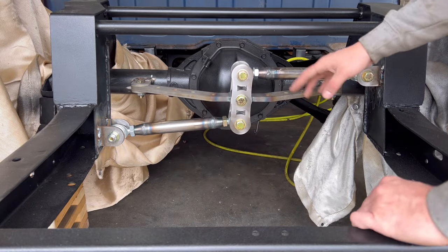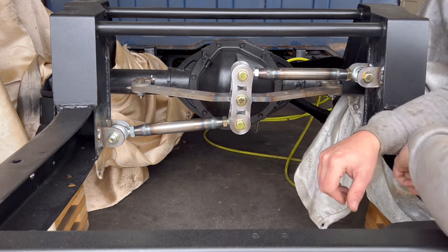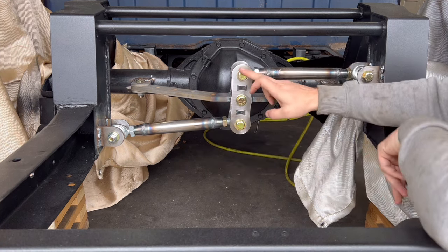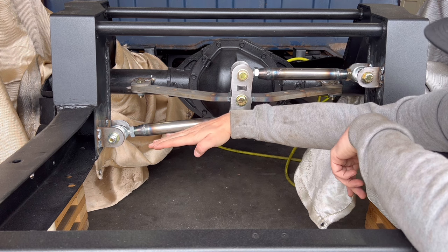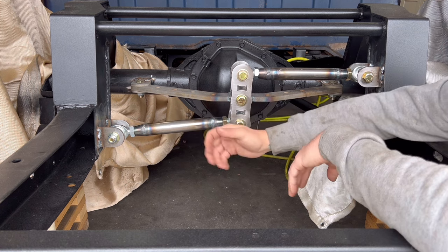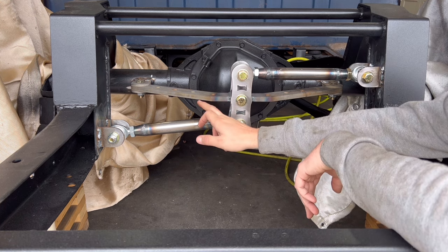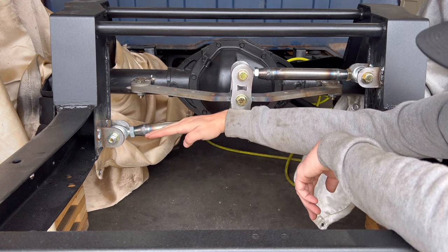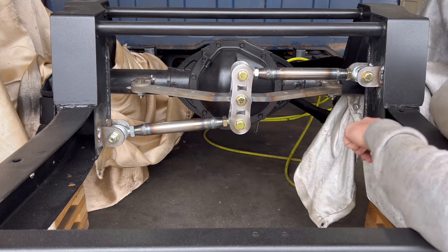I've got this tacked in enough to test it now. At right height, you want these two bars pretty much even and the center piece straight up and down. This bar is slightly down — I did that on purpose because when I had it straight out and tacked in, when I aired the truck up to full max capacity this bar was really close to this piece when it angled up. So I needed to drop it down about another inch so when I air the truck all the way up there's plenty of clearance — I'll show you that right now.